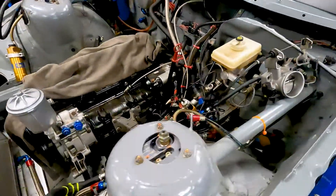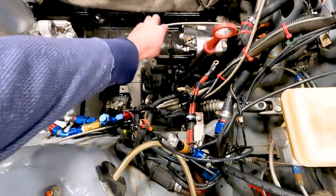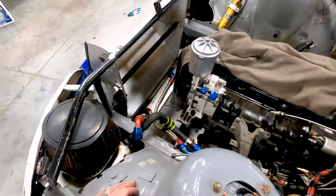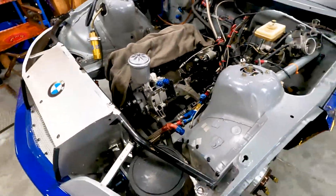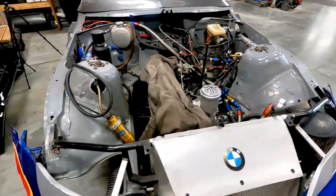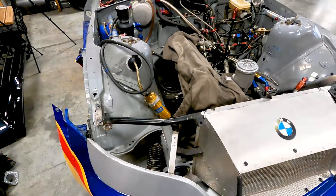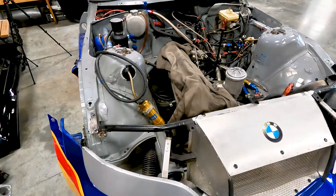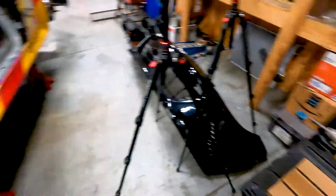The BMW engine and transmission are ready to be pulled. I've got all the lines disconnected, all the wiring's disconnected. This is just the bleeder for the annular clutch — I'm keeping the cover on it. Obviously the radiator is out. All I need to do is loosen up the engine mounts and the tranny mounts and out she comes. I'll get it out, get the transmission off, get it up on the stand. I want to replace the oil pan gasket — I tried something different when I installed this gasket and I was just getting a couple little drips which annoy me, so I've got a new gasket over here in the box.